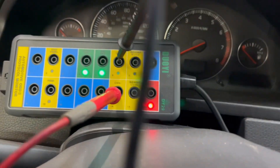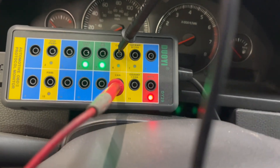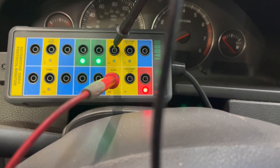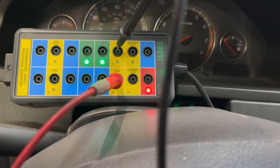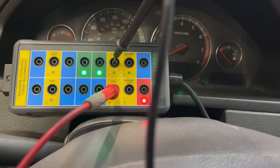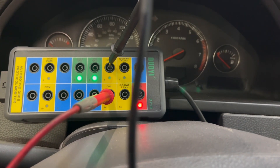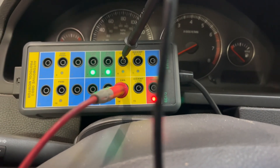There are two 120-ohm resistors in a CAN bus circuit. If you're reading 120 ohms, that would indicate an open in the CAN bus circuit. Readings that are low would indicate a shorted CAN bus circuit, and high readings would also indicate an open or a bad module — that's what I was worried about. Being as though we're right in spec, we are most likely not looking at an issue like that.